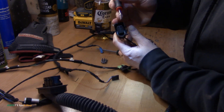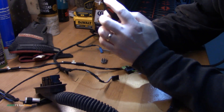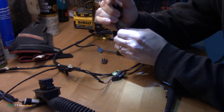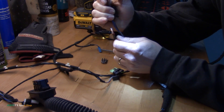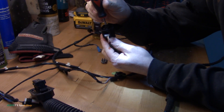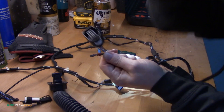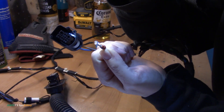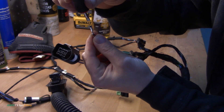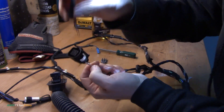And how these work — there's compression tabs on each side. So what you want to do is get your tool and just slide it in. Hold your de-pin tool and put a little pressure on it; you don't need a lot. Just make sure it's home. Then take your wire and push it up and down. You'll see that when you go to de-pin, the tool itself will fall all the way in. When the wire comes out, the pin falls all the way in. There are just two little tabs — when you put your de-pin tool in, you're going on the other side of them and pushing them in, which releases the clips so you can pull the pin out until it falls into the housing.